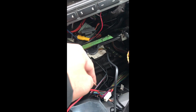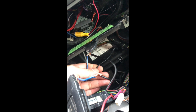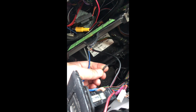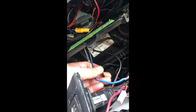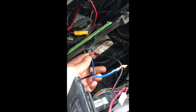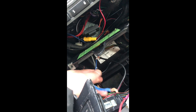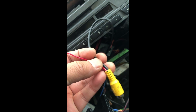This is terrible wiring — most of the wires here don't have covers, and this is your 12-volt power without a ground. This is like an electrical disaster. The previous person working on this car doesn't really know how to do electrical work. This one I think is for the auxiliary — actually for the backup camera.